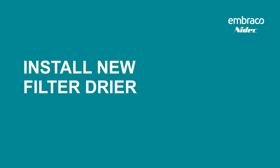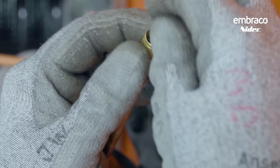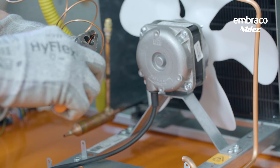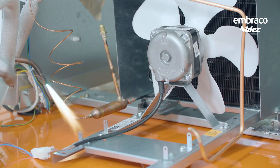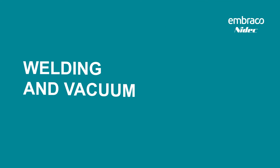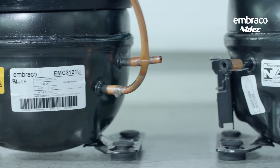Now we can install the new filter. It's necessary to use the correct type of filter for each refrigerant type — for R290, make sure the filter is certified for R290 use. In the extra connection, install the Schrader valve, then connect the filter to the condenser outlets. Bend the capillary tube and braze it into the other end of the filter. Remember to compare the label on the old compressor against the new compressor to check the gas type and ensure you have the correct replacement. Also check the equivalent capacity and connection compatibility.